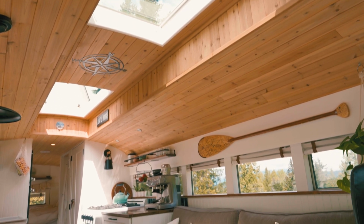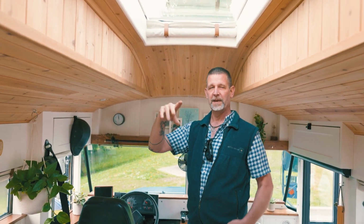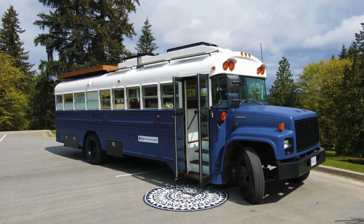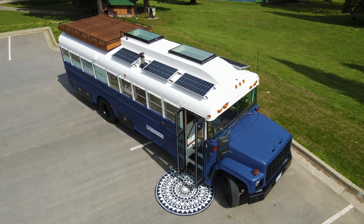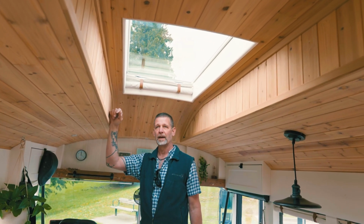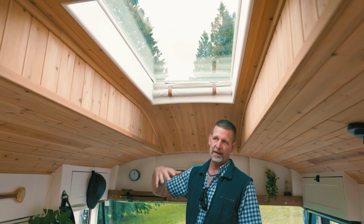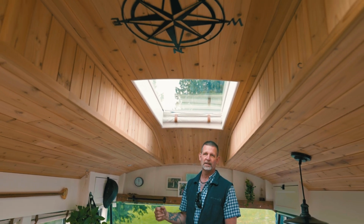We did the raise, which is 10 inches that I raised the bus ceiling just down the center. So basically I built 2 ladders that had the pointed shape to them out of 1.5 inch square tubing, and then sheeted those with the actual skin that we pulled off the inside of the ceilings. And then did the seal work with the silicone paint and everything. The wood is cedar, and it's unfinished, and I left it unfinished because of the ability for it to breathe and dry, so you don't get moisture issues, trapping moisture in the ceiling and stuff like that.